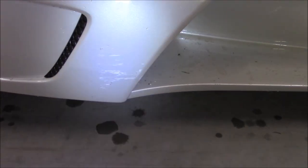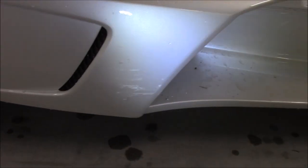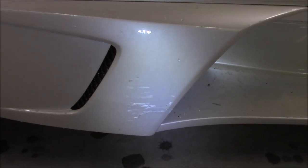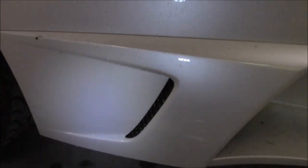It's got some nasty spots where it's gone all the way through, but I'm really hoping that by the time I take the PPF off, that panel will be good and I can just do a light polish and we're in good shape. The plan is to clean it up — basic detail, I maintain this car, you guys have seen it in lots of videos. But specifically to fix that spot, I'm gonna get my heat gun, take the paint protective film off, and then assess the damage.